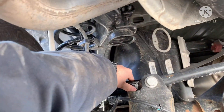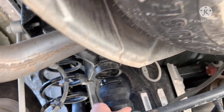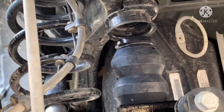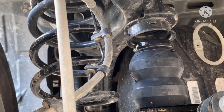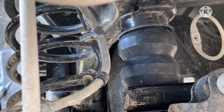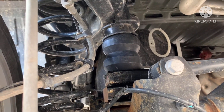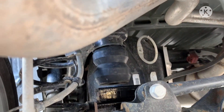The 2x4s are going up onto the perch. I'm putting the timbren in place and lining it up as best I can. ECM is slowly going to lower the truck while I make small adjustments, staying safely out of the way. Go ahead, nice and easy — lower down at that rate, perfect. All the way down. Jack it up, timbren is in place, take your blocks out, and lower down.